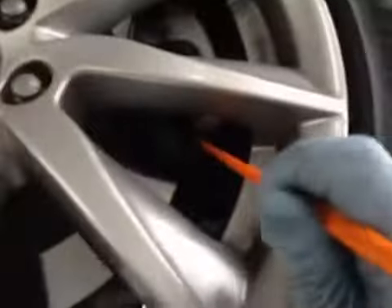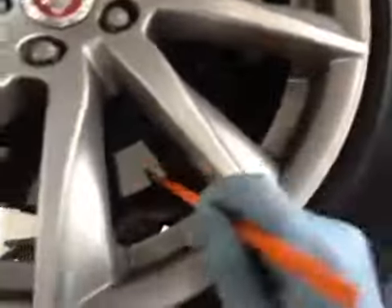The tyre is in amber on the health check. The same on the driver side — the tyre again is just below 5mm. No signs of abnormal wear on the tyre. The rear disc is in OK condition and the rear brake pads are on 5mm. The pads are in amber and the tyre is in amber on the health check.